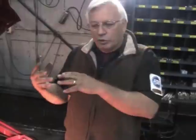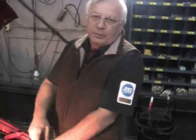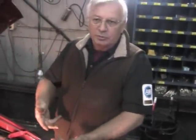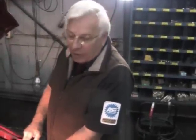Now to test this, make sure you understand the parameters you're testing. The computer is going to turn the cooling fans on if the engine is warm, and/or the air conditioning is on. If the engine is cold and you're testing, you should go to this wire and there'll be no ground. If you turn the air conditioning on, that wire should get ground. If the engine is warm, there'll already be a ground because the engine is warm — the coolant temperature is telling the computer to turn the fan on. But either way, if there's a ground connection on that wire, the cooling fan should run.